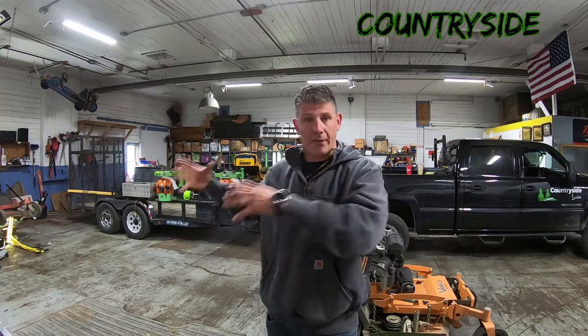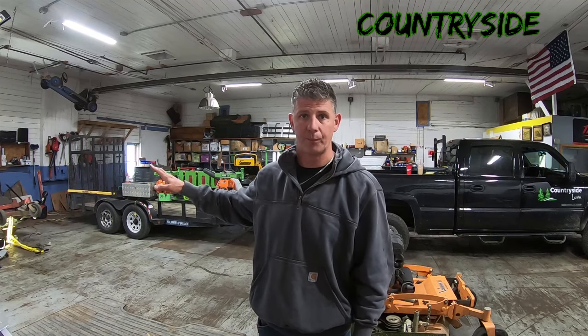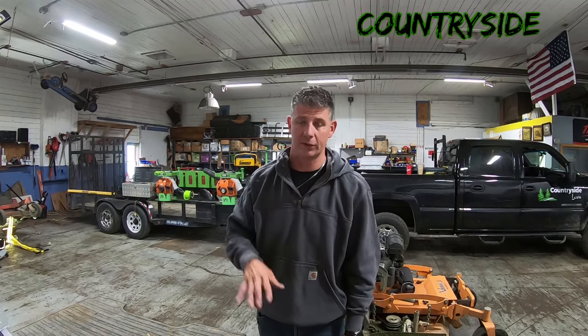Now, let's discuss how it affects the machine. This is where a little common sense comes into play, and this is huge. Running X-Blades, I would never engage my blades at full throttle. You have 6 blades under there, and when you put 6 blades on and hold it up by the center bolt, it's a lot of weight. It's heavy. So does it put more draw on the machine? Yes, absolutely. I burn a lot more fuel running X-Blades on that Toro than when I just have 3 blades in there. So it burns more fuel, which means, yes, the engine is working harder.